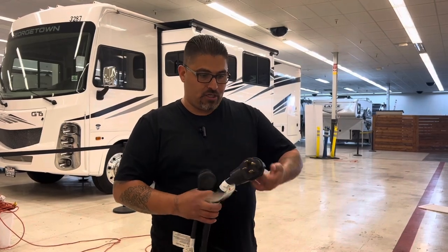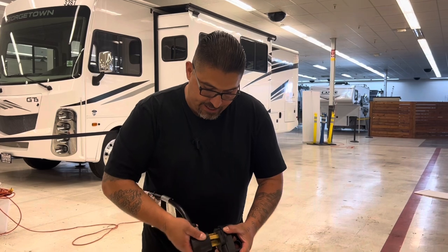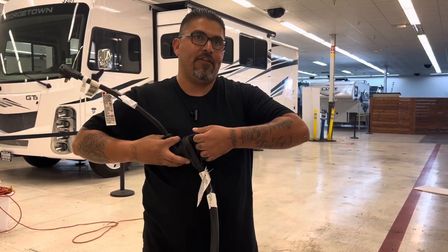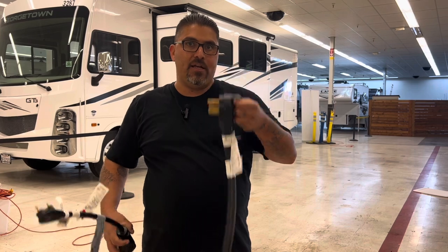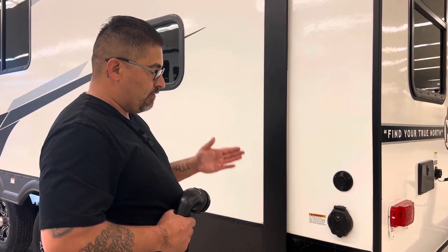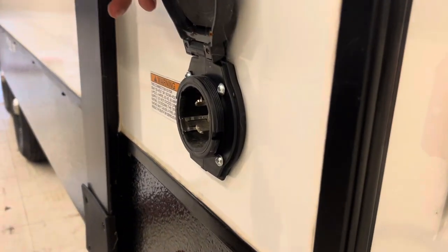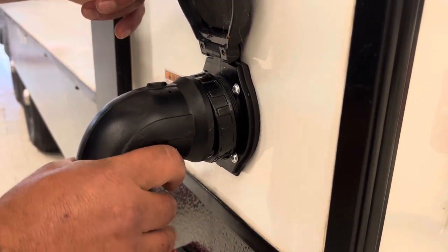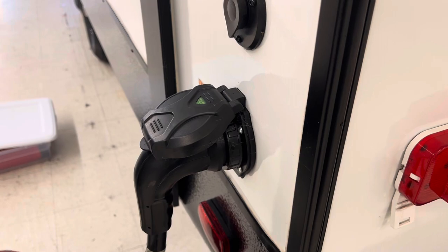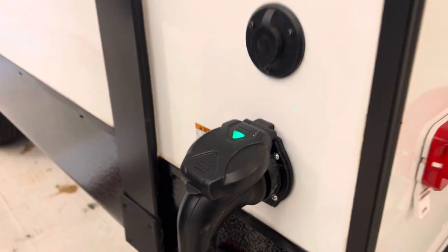This coach is a 50 amp coach, which means it uses this plug, but you'll also have an adapter that goes from 50 to 30 amp in case the campground only has a 30 amp. If your campsite is 50 amp, use the 50 amp plug and place the adapter in storage. Next, we're going to plug in the shore power cord to the travel trailer, located at the rear driver's side. Lift it up, stick it in, twist it a little to seat it, then thread it on nice and tight and plug it into the campsite. Once plugged in, ensure there's a green light if equipped, and make sure you turn your breakers on at the campsite to ensure you're getting power.